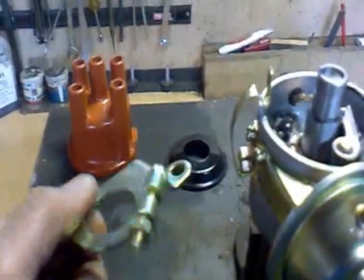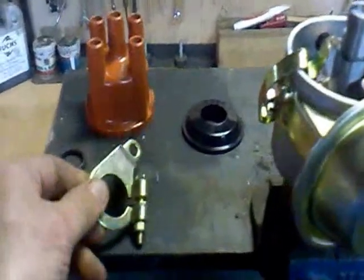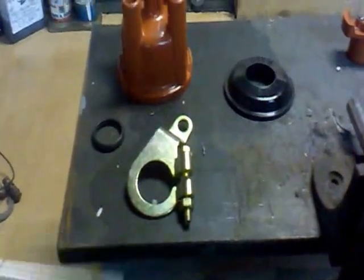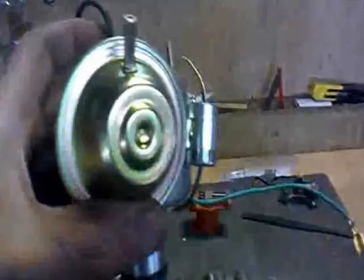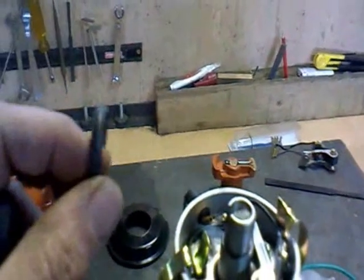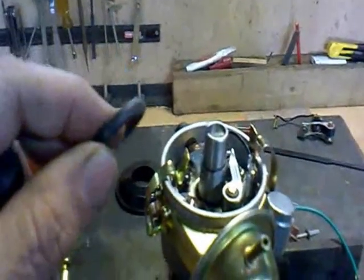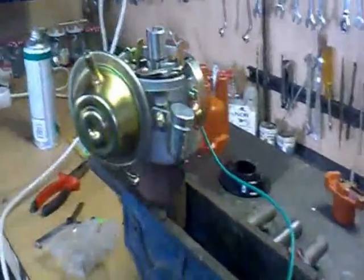This is the base clamp we're using. This distributor is being sent off to someone in the UK, and you want a nicer barrel nut recovered off your old distributor — a long nut so you can easily adjust it when the engine's in the vehicle. The rubber gasket that comes with it is rubbish and doesn't even fit properly. In an ordinary engine overhaul kit there's a proper gasket that's flat on the inside and curved on the outside — that's the one that fits, and you want it to drop nice and easily into the engine block.